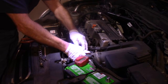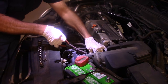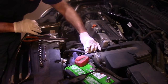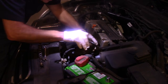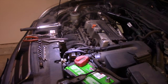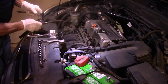We're going to pull these wires out of the way and disconnect that little piece right there — push that little tab in and you can pull it to disconnect it. There's a very small vacuum hose down underneath there as well, and we're going to remove that vacuum hose. Be careful not to damage anything because we do have to put it back on. Be very careful because sometimes these are held on with little wires in tabs, so we have to be careful when we take that off. Now I'm also going to remove this latch right here because it can interfere with the plenum coming out, so I'm just going to relocate it off to the side.